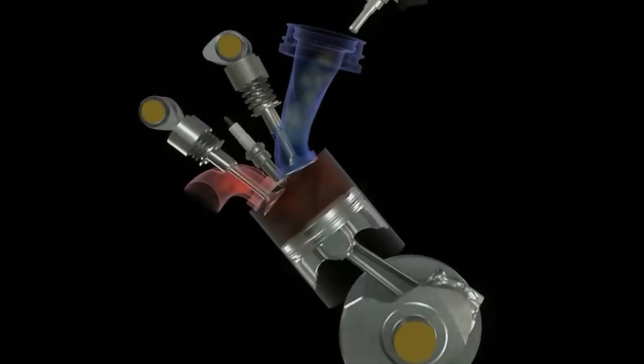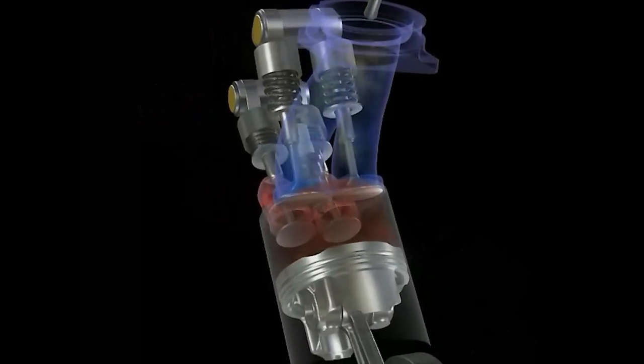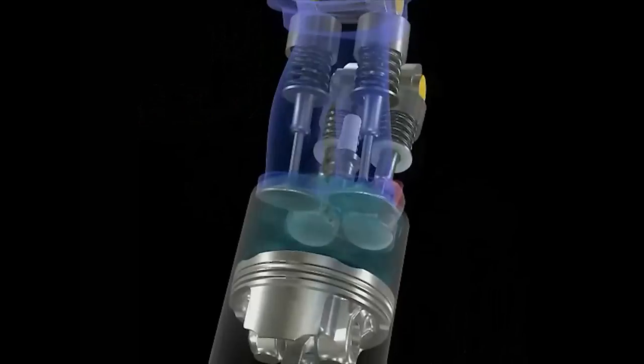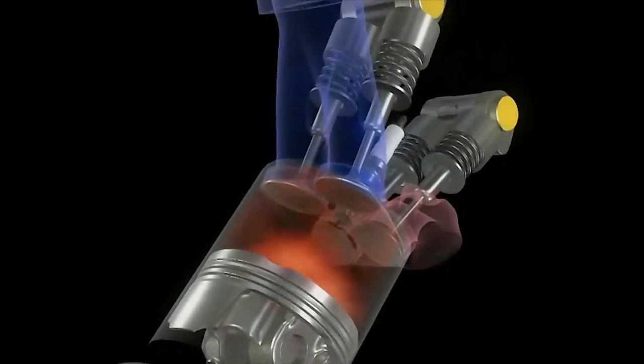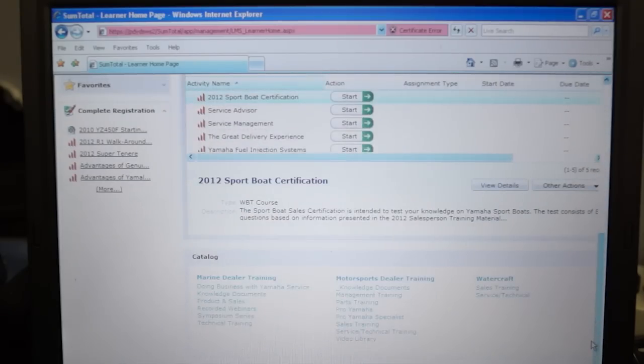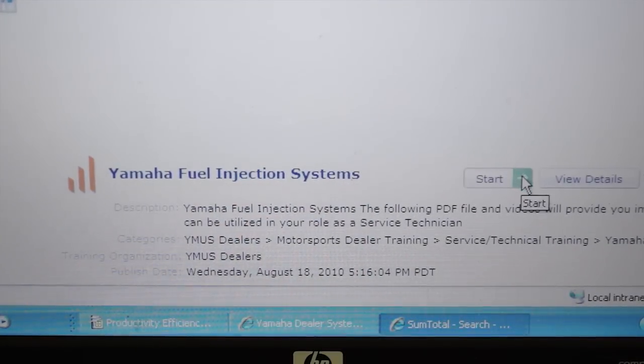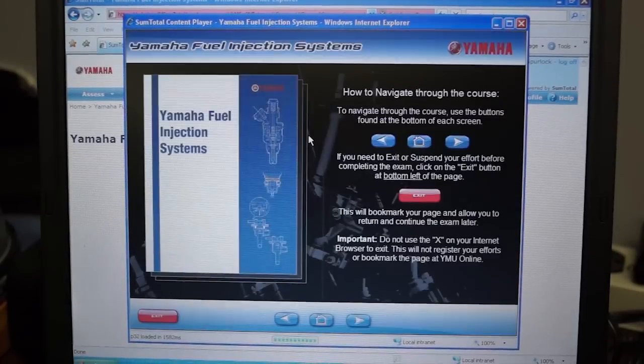We are going to be spraying more fuel into the engine than is normal for the fuel injector Diag test, so please do not cycle the run-stop switch more than six times unless you start the engine or at least spin it over several times between tests to clear out the excess gasoline. That's it — thorough electrical and mechanical testing of the fuel injectors, and in most cases all we needed to do was remove the seat to get access to the ECU, and maybe remove a side cover or pivot the gas tank on sport bikes to access the fuel pump and fuel hose. For a full overview of the Yamaha fuel injection system and onboard self-diagnostic functions, please complete the Yamaha fuel injection system's self-paced training module through Yamaha Motor University. Thank you for watching.